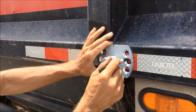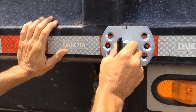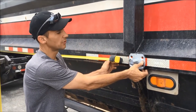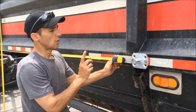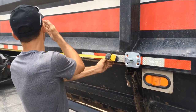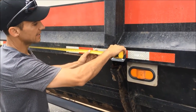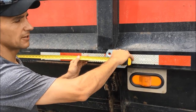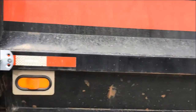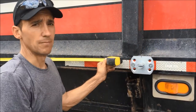In this case I'm going to use the left and right holes, drill my holes, and secure it. We have our pivot point all installed and secured — two half-inch bolts going through and secured on the back side. So this is on the driver side. On the passenger side, rather than taking my tape measures and trying to find my center point, I'm simply going to measure off the front of the trailer to the center of the pivot point itself — in this case about 267 inches, just under 267 inches. I'll also take a measurement off the rear to double check, and then mount the pivot point on the passenger side based on those two measurements.